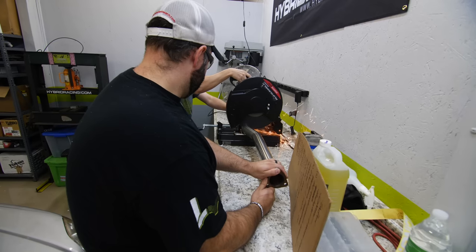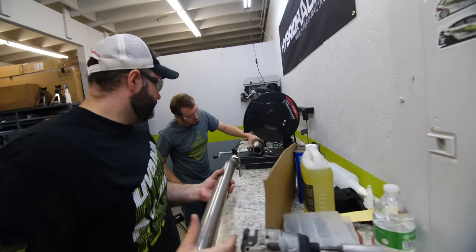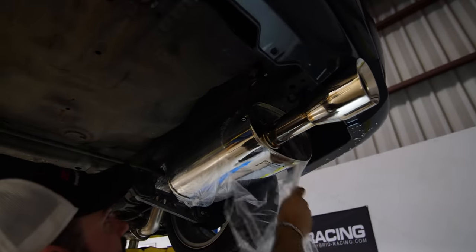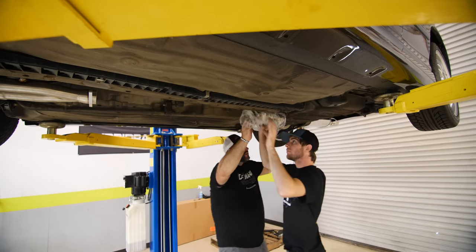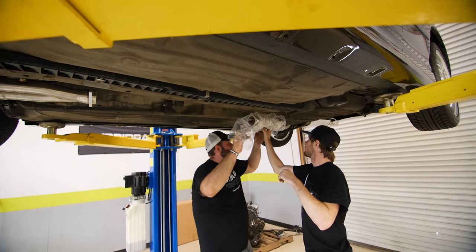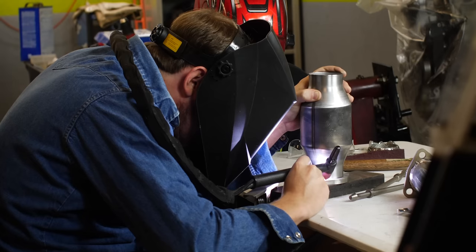After a successful drive and a classy dinner at Taco Bell, the very next morning we got to work on getting rid of that nasty raspiness from the open header. We decided to go with a Tanabe medallion exhaust, but since it's made for a B series, we needed to make our own custom exhaust. We went with a Vibrant high flow cat, along with modifying the rest of the piping.